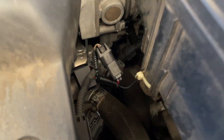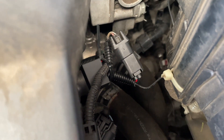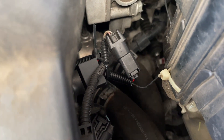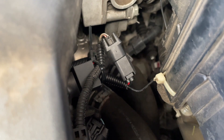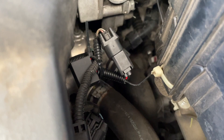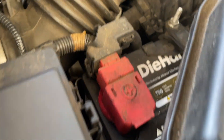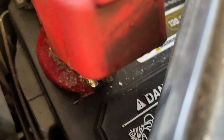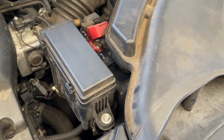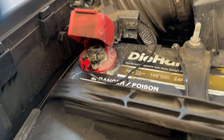The last piece of this to get done — now that we have this in here, it's looking good. One side note about the zip tie: having left it somewhat loose, I only clicked it about five times. The loop is probably an inch in diameter, and I wouldn't want it much tighter given the way those cables are connected. Next step is to connect this lead to the nut on the battery terminal. We're not taking the entire connection off, but we're going to take that nut off, put the lead underneath the nut, and then put the nut back. I'm having a little bit of trouble getting to that nut, so I'm just going to remove these pop-up plastic clips and take this air intake off — it comes off really easily after that. Okay, it's on there — nut is back on.